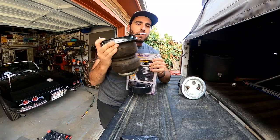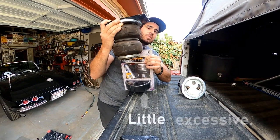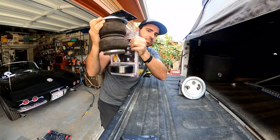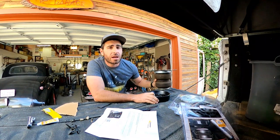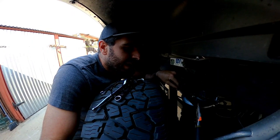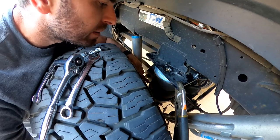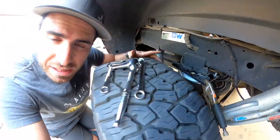Basically when we're off-roading, the airbag is going to be mounted like this so the rear axle can droop freely. The airbag stays in one spot and the axle moves. All we have to do is bolt the cups to the axle and put the airbag back in. I have the bag clamped in with a vice grip and the Daystar cups are sitting in place, all lined up perfectly — checking to make sure they'll land in the right spot as the suspension travels.